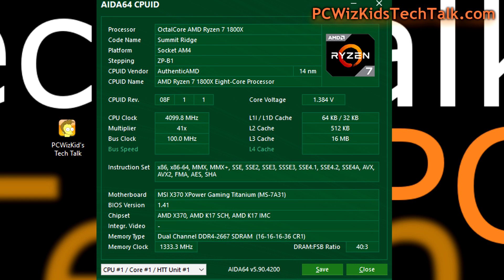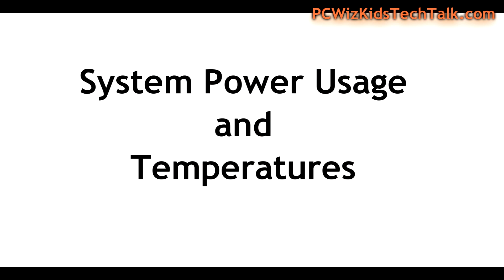Here in Windows 10, I enabled the power options to be high performance, so that way I'm not having any CPUs parked and there's no throttling — I'm using the full capabilities of the CPU. You can also see here the voltages and the memory timings, which match what we have in the BIOS. When it's on no load the voltages will be lower; when it's on full load the voltages might go a little bit higher, so the system is compensating for that.